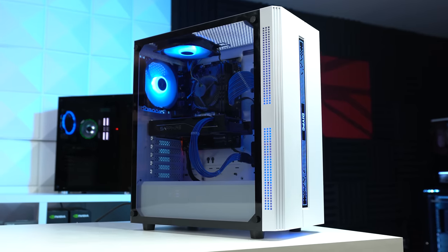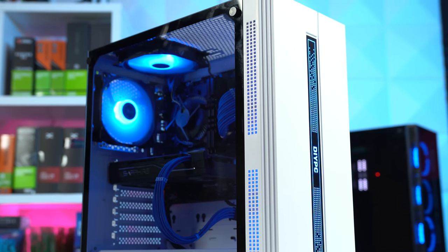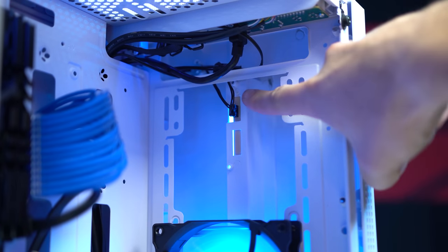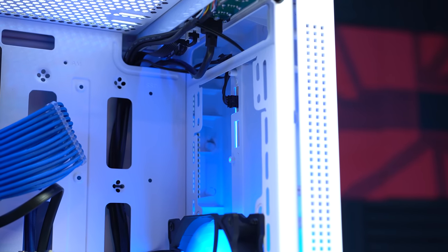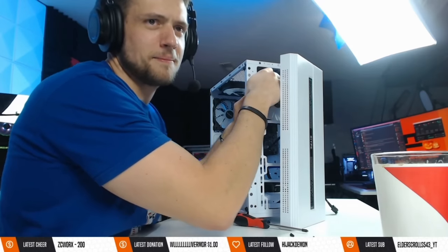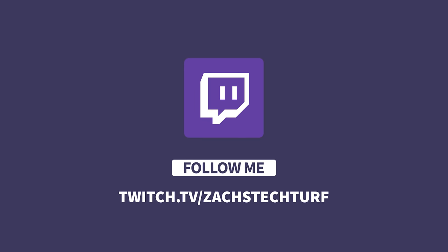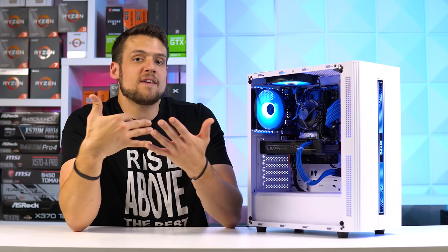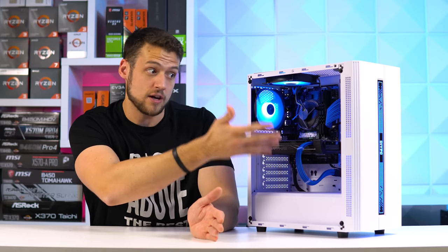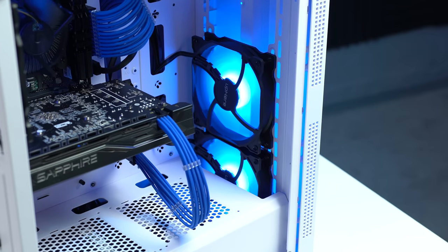Next up is the case: the DIY PC Rainbow Flash S1W. I explained in the TechFam collab video that I really like how it looks, especially with proper RGB fans giving it a nice blue glow. But I discovered a critical design flaw that's just unacceptable. The front panel RGB port that illuminates the RGB strip sticks out directly behind the panel through the main frame, meaning a front intake fan can't spin because it gets in the way. Instead of installing three 120mm fans like I originally tried on my Twitch livestream, I had to remove one and only keep the bottom two. The case is advertised as fitting three fans and even has cutouts for three, so I can't believe it made it to production like this. You could use a radiator in a push-pull scenario, but for a pure air-cooled setup, three front fans simply aren't possible.